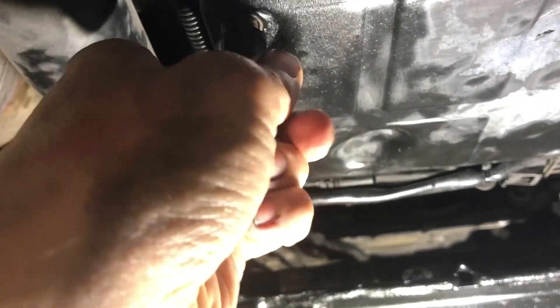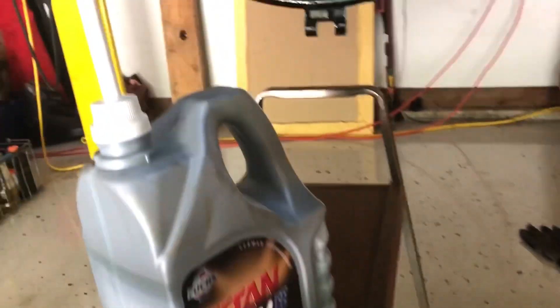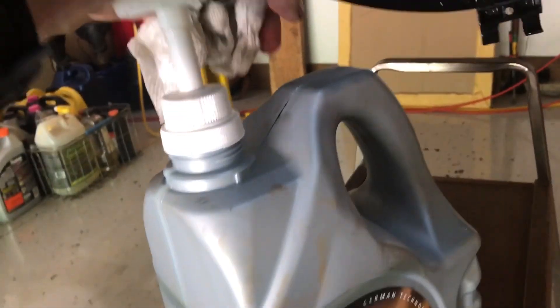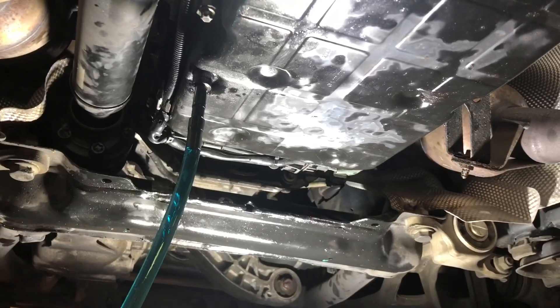This is the tool for filling - it really just goes in the drain plug hole and provides a way to hook a hose to pump fluid into the transmission. You can see it's just put in finger tight, and then we hook the pump hose onto here. I've got the hose hooked up and you can see my setup for pumping - got the pump inside the fluid on my advanced pumping stand, which some of you might recognize as an old TV stand. I'm pumping six liters into the transmission pan at this point, which is how much we put in before starting the engine.